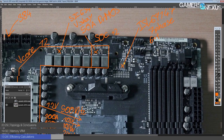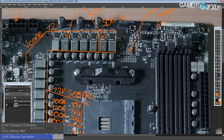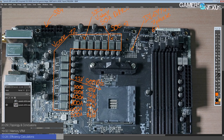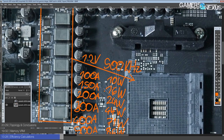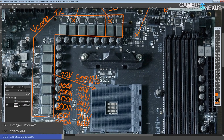The SOC VRM uses more of the 50-amp Vishay DRMOS components. We're not really going to talk about SOC VRM efficiency — this voltage regulator doesn't need to push anywhere near as much power as the V-Core, so this is quite frankly overkill. You can build significantly weaker phases and still run the system-on-a-chip portion of a Ryzen CPU just fine. No concerns with that from me. I think this hits the sweet spot for a VRM for a Ryzen 3000 series CPU — really good efficiency in the reasonable current range, and no complaints considering what ASRock is targeting.